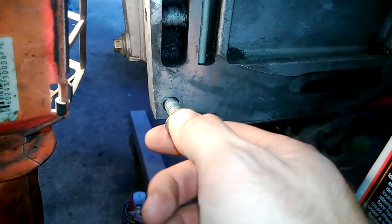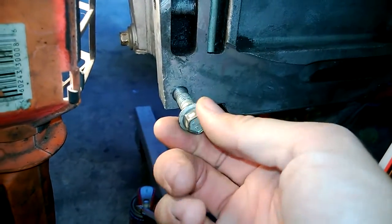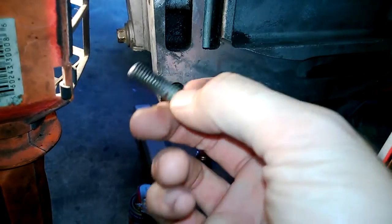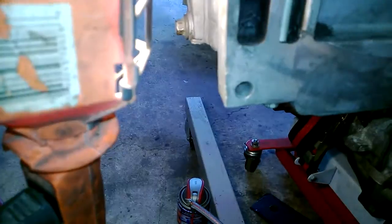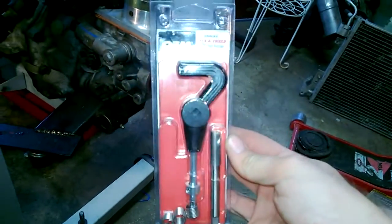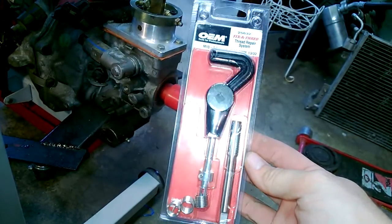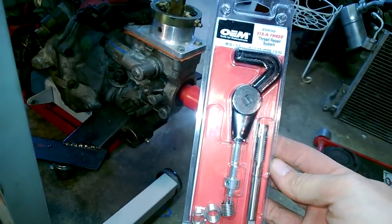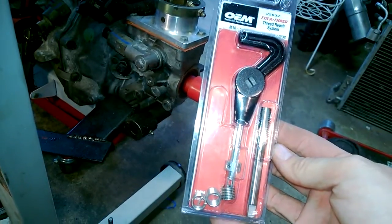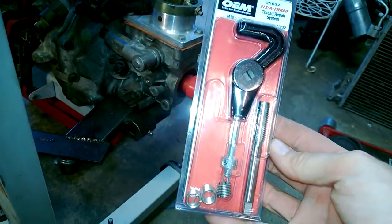It's been like that. I actually didn't even have a bolt in there — it was kind of stuck in with red Loctite, maybe catching on the last few threads. But now it's completely stripped. So what I got was one of these fix-a-thread kits. AutoZone sells them, it's like 30 bucks. I have the 8x1.25 kit and this one. If you got the M6x1s too, you could pretty much re-thread every hole on this motor.